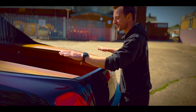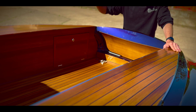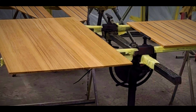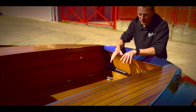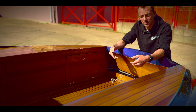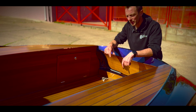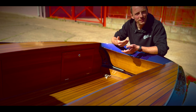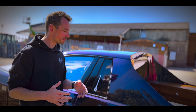It's all controlled by the standard Bentley button, gapped up perfectly around the framework, which sits underneath the wood. The wood was made by a yacht builder from down south — an absolutely awesome job. Templates were made, the car went down to him for a couple of months once it was in primer. A fiberglass shell was made for the inside of the bed so any water won't get into the car and rot anything. Fiberglass backs were made for all the cabinets as well, all covered in yacht wood. Three stages of matte lacquer were applied — about nine coats in total — fully flatted back and ceramic coated.